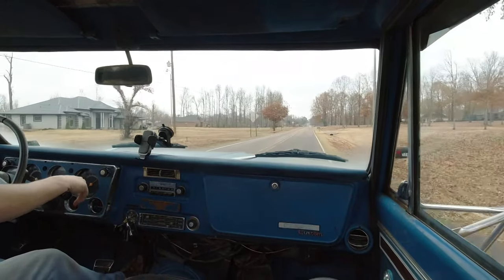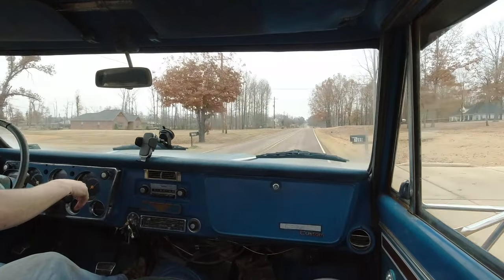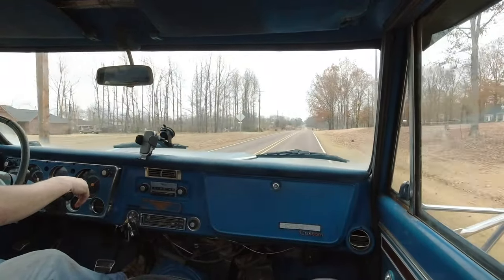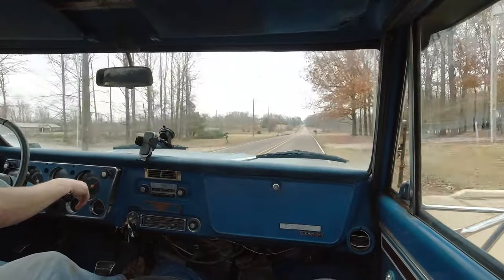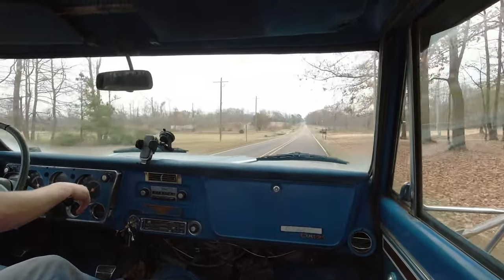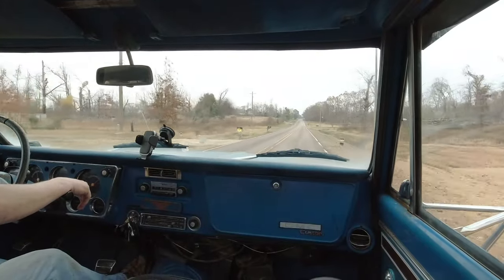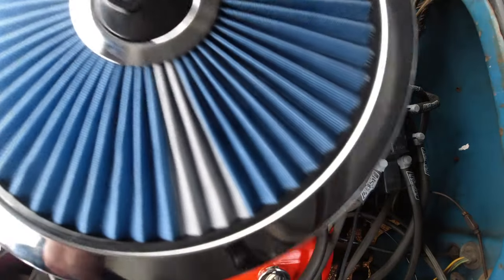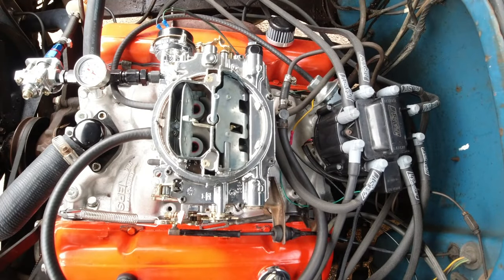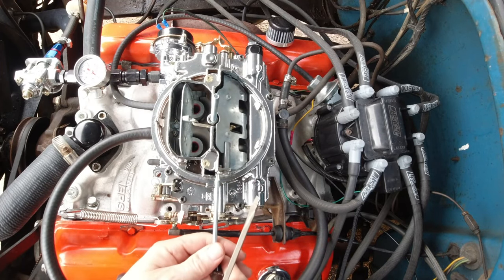It's a really nice, cool calibration. Works very easy. One of the problems is the older Performer Series carburetor does not have that AVS door on there. You have to use the Thunder Series carburetor, which I'm not sure is still available. The new carburetor from Edelbrock, the AVS2, has that secondary door on there and allows you to make those changes.